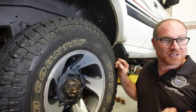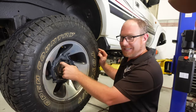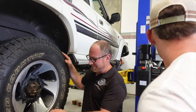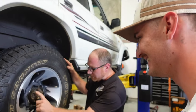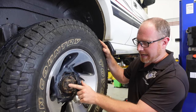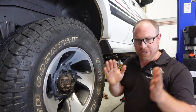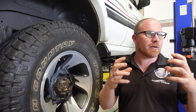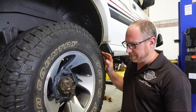So check yours. How did you do it, Michael? He may have taken the hammer approach. Might have. The other method is the bolts in there just to apply a bit of pressure and hit the end of the axle. And it just causes the axle to bounce and push the cones and release the cones out of it. Okay. Oh, well, there you go.